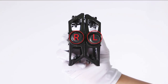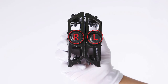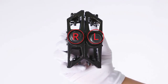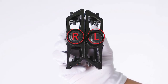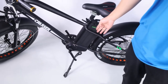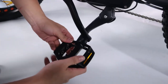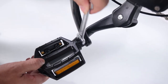Step 8: Install the pedals. Locate the pedal with an R stamped into the end of the pedal axle — this is the right pedal, which goes on the crank on the right side of the bike. The remaining pedal with an L stamped on the axle is the left pedal, which goes on the left crank. The right pedal tightens by turning clockwise; the left pedal is reverse-threaded and tightens counterclockwise. Carefully thread each pedal onto the crank by hand, then further tighten with the supplied double open-end wrench. Do not cross-thread or damage the threads.